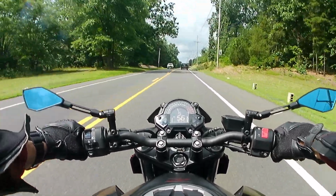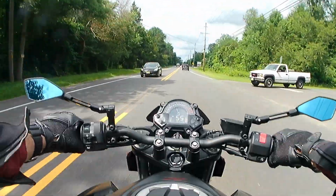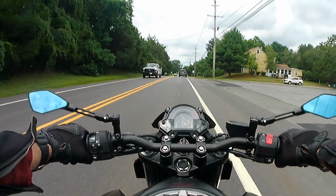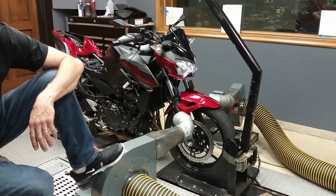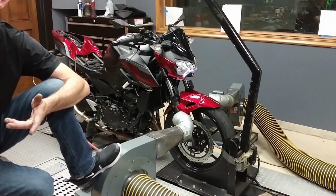When I'm done testing my 10% column, I'm going to go back, review my data, look at my carbon readings, and make the adjustment to the column. These are all 0 right now. If it's 0, that means it's not doing anything. It's not making a change, it's running off the stock ECU. Over here you can see some places it's taking fuel out. If I get a reading that's too high, I'll be taking fuel out. So those are -4s, and over here it's a +2.